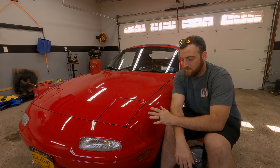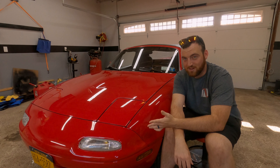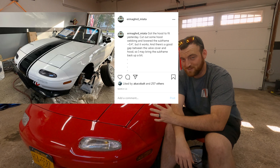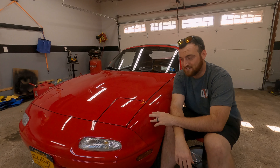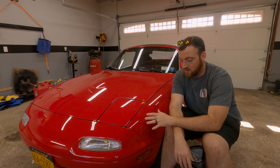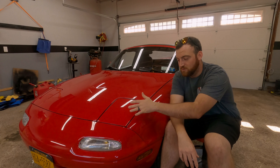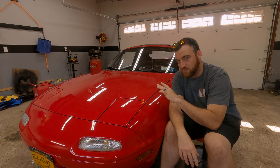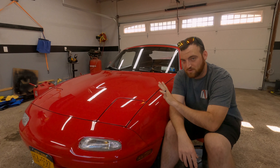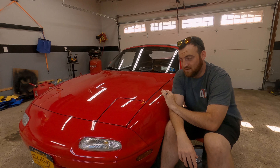It's expensive — you're looking at probably around two grand to have it done by a professional if you want it done really right. That's cutting out the old rust, hopefully sealing off whatever's inside, patching new metal on — which is sometimes a custom job — and then painting over top to make it look factory. I'm going to show you this rocker; both of these are perfectly mint still, which is great. I'll show you kind of where to look for rocker rust.